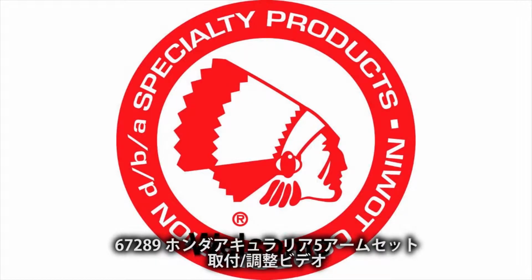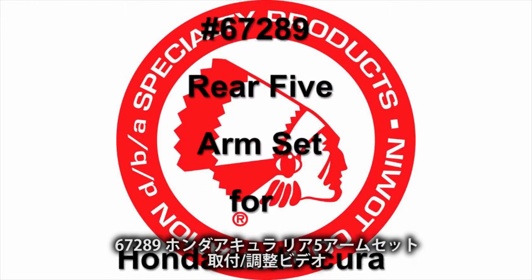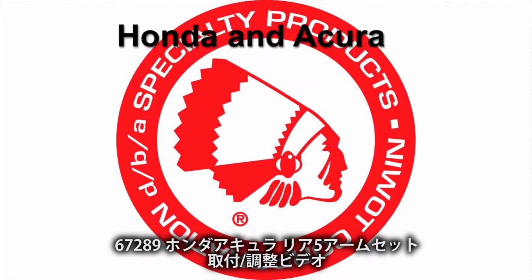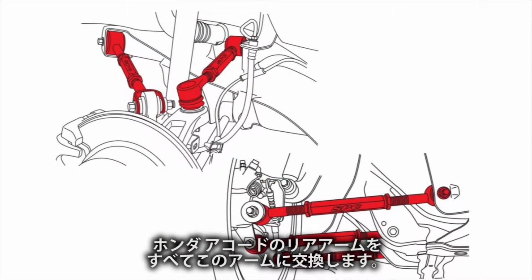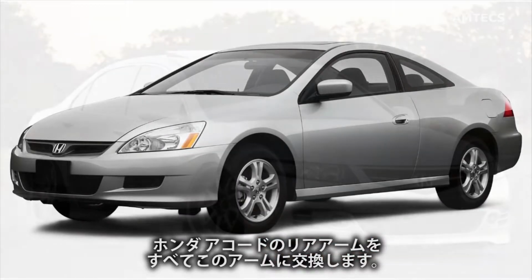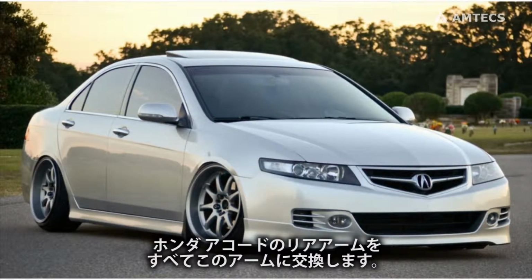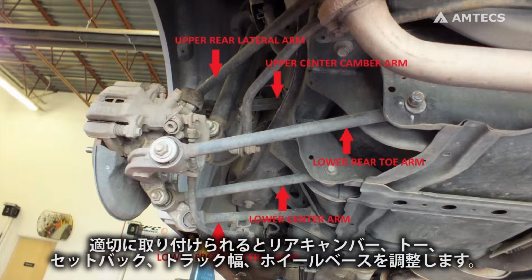Welcome to the Specialty Products installation and adjustment video for the part number 67289 Honda Acura rear adjustable 5-arm set. These 5 adjustable arms replace all the stock arms on each side of the rear suspension on the 2003 to 2007 Honda Accord and the 2004 to 2008 Acura TSX. When installed properly, they will adjust rear camber, toe, setback, track width, and wheelbase.